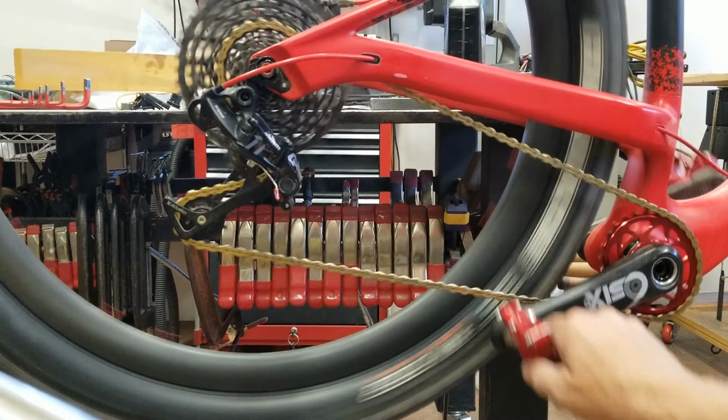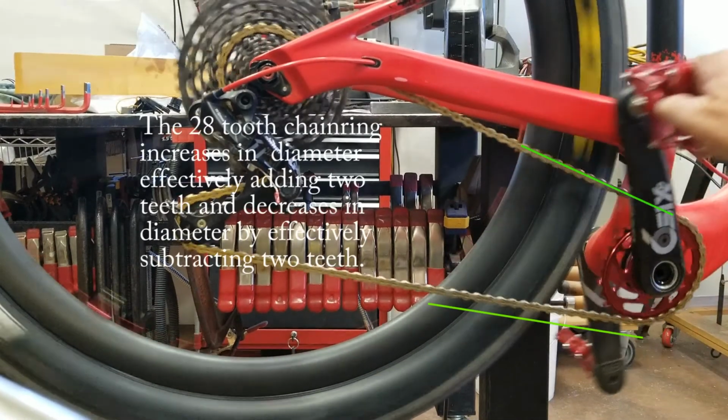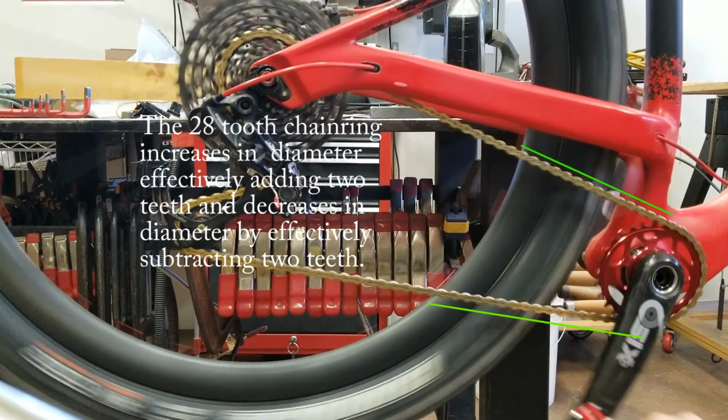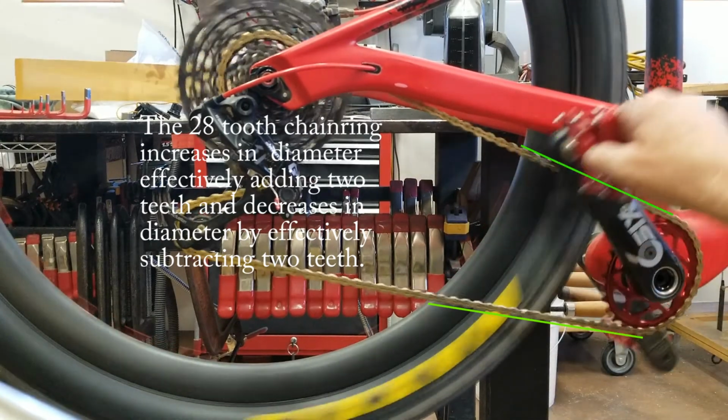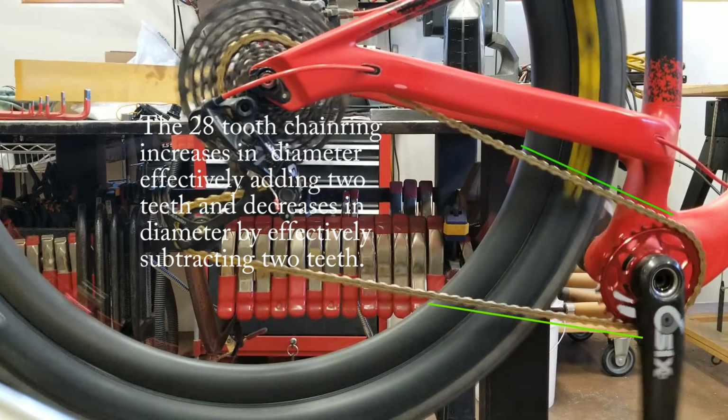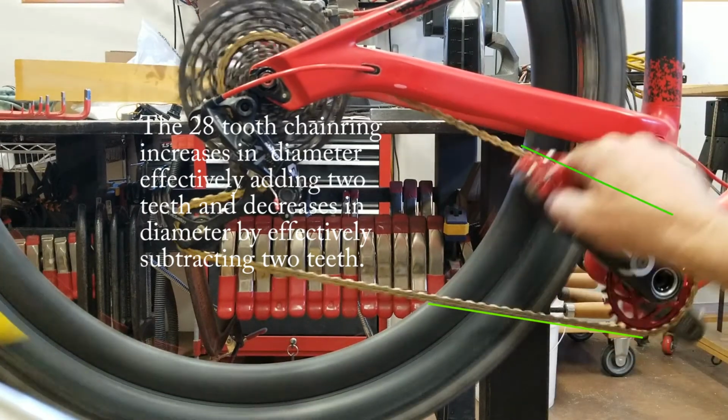He states that the forces applied to the pedals within a crank cycle are not constant. Of course, we already knew that. The minimum torque is normally produced at the top and bottom points of the crank cycle, and the highest somewhere between 90 and 110 degrees.